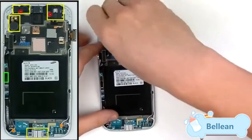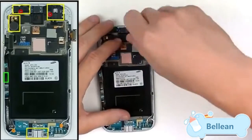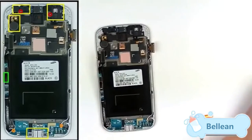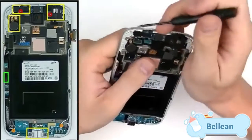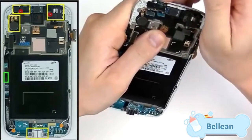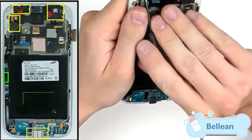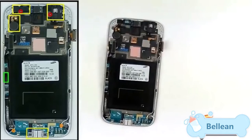Now focusing on the upper parts, we have two more small Phillips screws to remove, shown in red in the diagram to the left. Both screws will be the same size — the one on the motherboard will be black and different. Use a small flat head screwdriver to remove the cover here by getting underneath it. It requires a little bit of pressure — once you hit the right angle it should pop off quite easily.